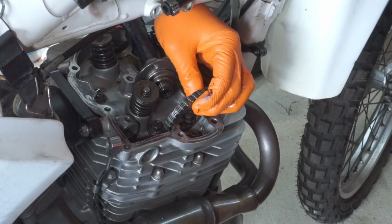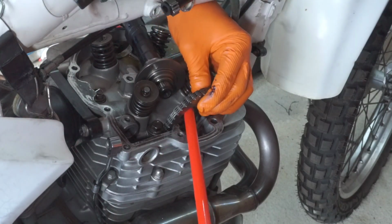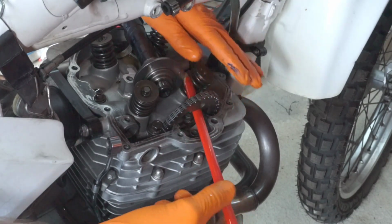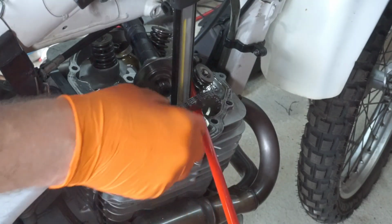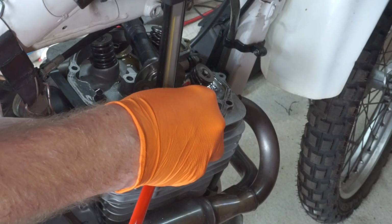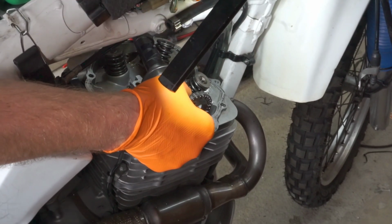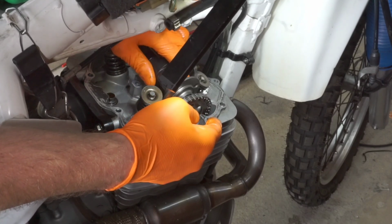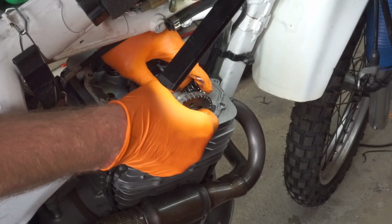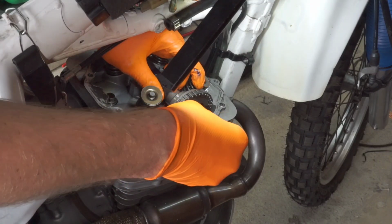First, I think you've got to establish which direction the chain is falling. Chain's falling. So I need a light really down there. And it's gone off to the right side, so I've got to figure out. Right, so I've had a bit of a battle, but I've got the chain back on the sprocket. So we've just got to keep tension on it. Fit this all back together.